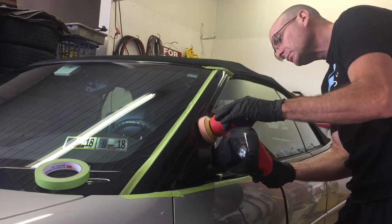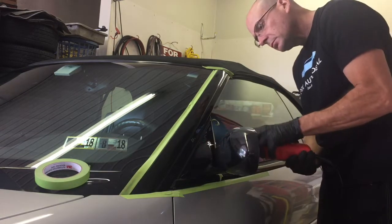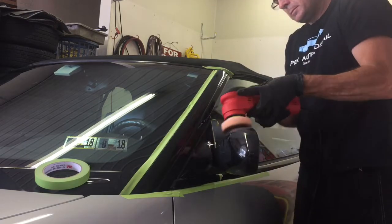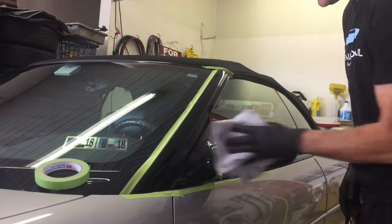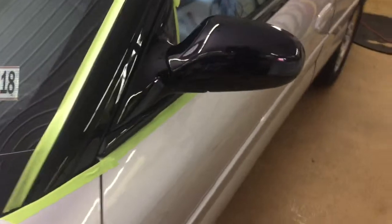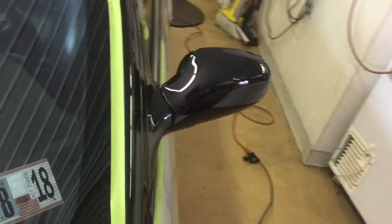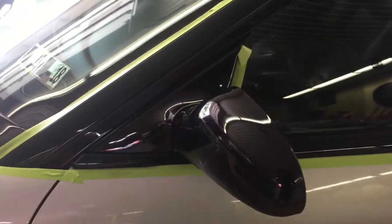If the vehicle has power windows, go ahead and move those front and back so you can reach with the polisher. If they're manual, just flip them front and back and you'll be able to get the polishing pad in there easily. Use some caution while removing the polish residue from the area. It's a good idea to have a top-quality microfiber edgeless plush and use light pressure removing the residue — that way you won't scratch and mar up what you just took all that time polishing.